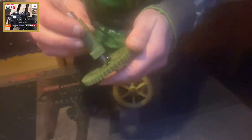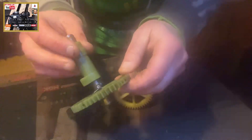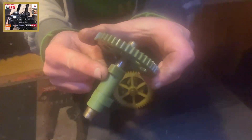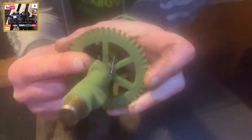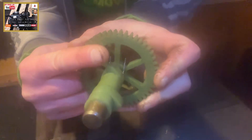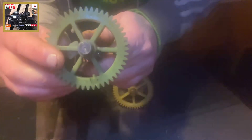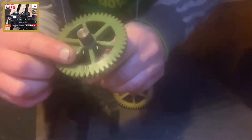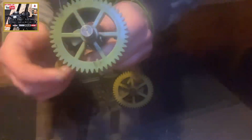In this instance, this camshaft is perfectly fine in working order. Here you have your exhaust lobe at the top end, which will line up. As you can see, index finger with that plastic tab there — that's your timing mark. On the top side, that timing mark is, as you can see, there's that plastic tab behind, but there's your timing mark.